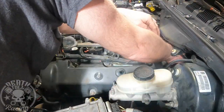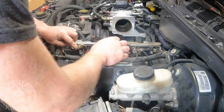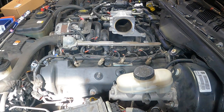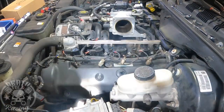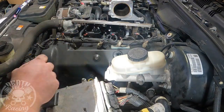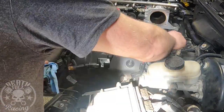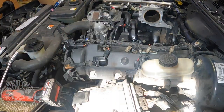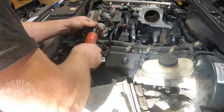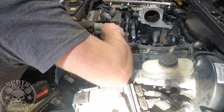We are replacing the injectors with the Deutschwerk — I'll just call them DW — 60-pound injectors. The part number is in the link below. We'll confirm they're the right injector when we go to dyno tune it; they're probably going to be pretty close. The coil packs on this car are from AC Delco. I originally had MSD coils when I first got the car, but one went bad and developed a misfire, so I replaced them with these AC Delcos, which have been pretty good.